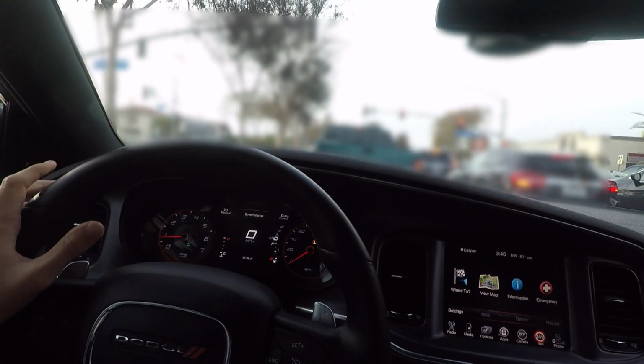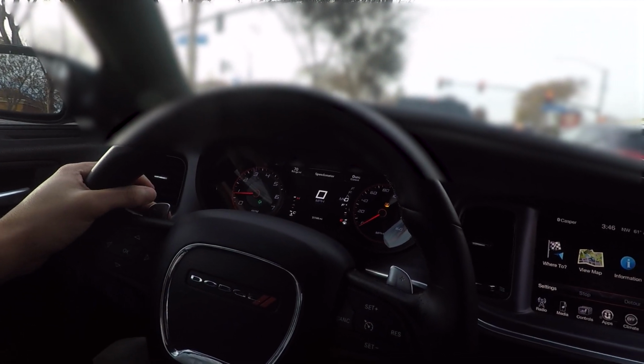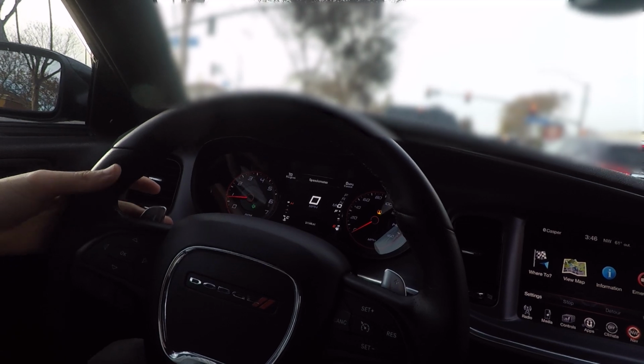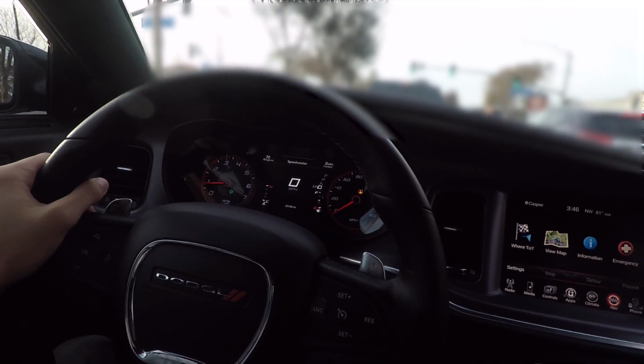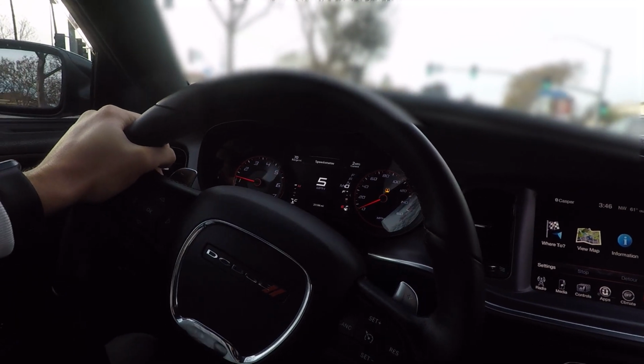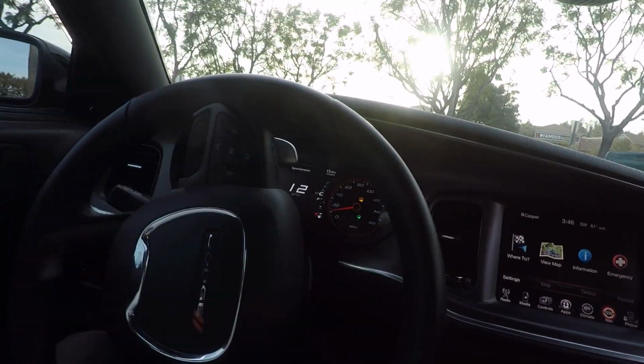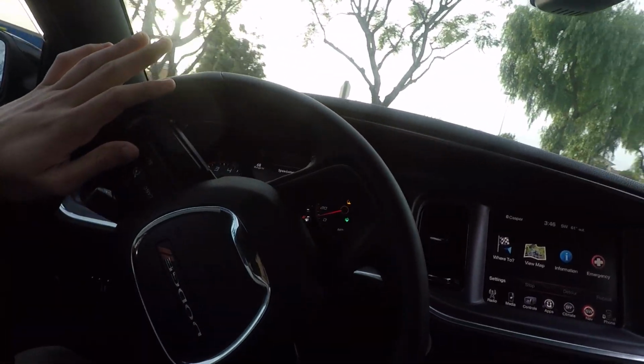It's not terribly loose feeling. The benefits at the track, I'm sure, are going to be great. I'm hoping I can cut at least 3/10 off my 60 foot, which in the 1/8 mile and 1/4 mile translates to even more time off of your ET. If you guys are worried about daily driving on this converter, I wouldn't be too worried as long as you don't go over the top with your stall speeds.